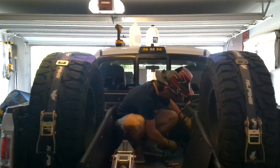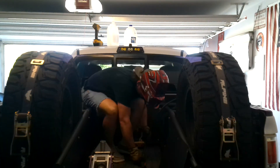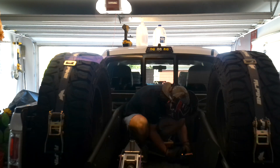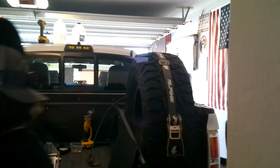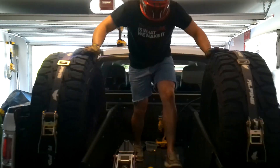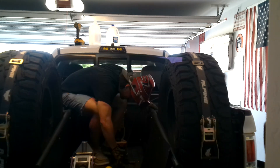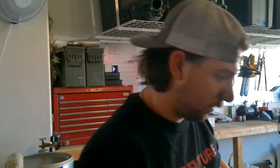Does my ground just suck? I think that's just as good as it's gonna get. Is that wire speed too fast? Let's try a little less wire speed. That is horrendous. I mean it's more solid than it was but the weld is terrible — it's not getting hot at all. See if we can preheat it — okay she's glowing. Less wire speed is definitely better. There's a big ugly glob. Those will hold but those are probably two of the worst welds I've ever done — I suspect it's because I'm out of gas.